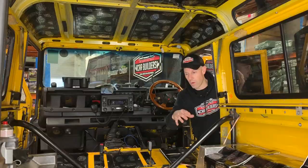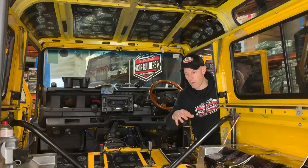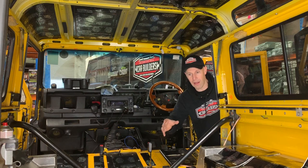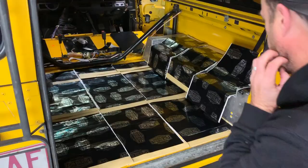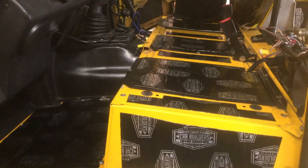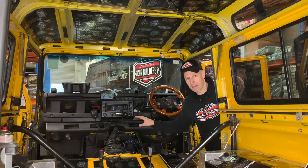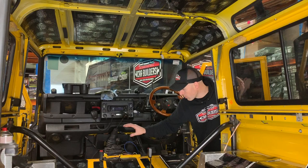So on the floor, we've done a tile layout to work out where we're going to position the mats. Rather than just start sticking them in everywhere and then go, oh, I've pulled up short up here - what you're best to do is work out the areas of concern. Treat it like a heat map here in this big flat floor cargo area and these rear wheel arches. We've concentrated on them and we've laid all the tiles out - they're not stuck down yet. Something to consider in this vehicle is we're not pulling the dash out, and it's fitted with an aircon unit which makes it hard to get up under those areas.